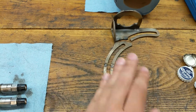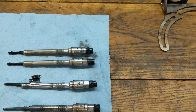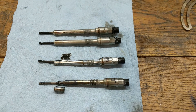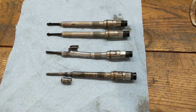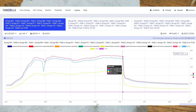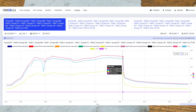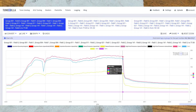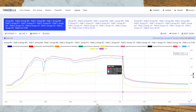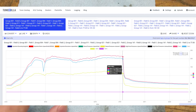I was going to run some logs for the cylinder pressure and I found that cylinders one and two were about the same at around 220 bar. Cylinder three was about half of that — around 100 to 130. And then cylinder four was flatlining at zero.